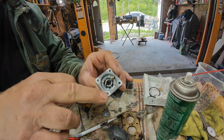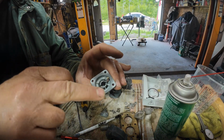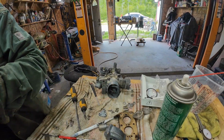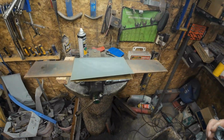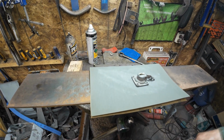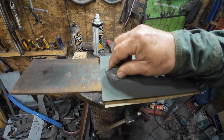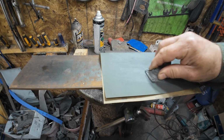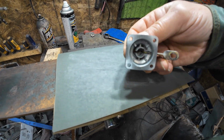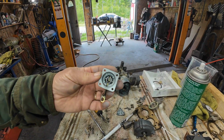So you see this, I just did a little bit of sanding on those right there, and these are high spots, so I have to sand that down so it's flat, and that will make a better seal on that thing over there. I'm just using my piece of flat steel, same thing as I did with those bearings, which I shouldn't have been doing because I just ruined them. But if I keep working on that, I'll get that so it's all shiny and there's no bare bits left. I'll just work on it a bit. Yeah, there, that should generate a reasonably good seal.